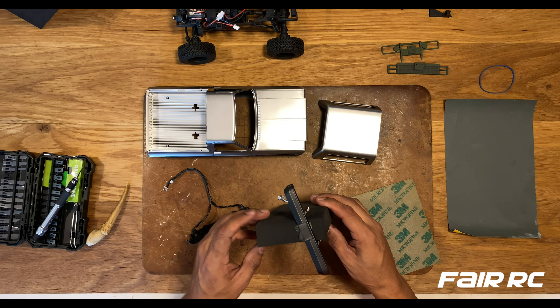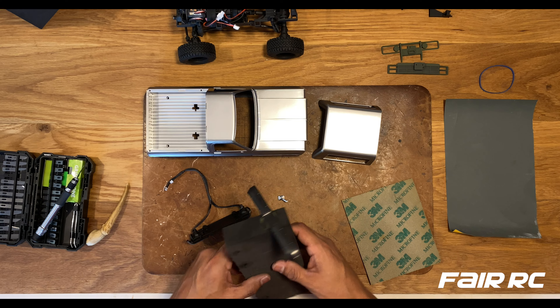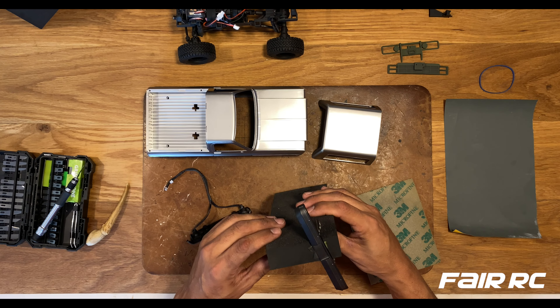Now when it comes to chrome, I do use a little bit of heavier grit — I'll use a 1500 wet dry, and I do wet it. For the chrome bumpers, I did put a little bit of black primer on, just a very light coat, just to give the paint a little extra something to hold onto. I did sand it ahead of time, but still, it being chrome, I didn't want it to come flaking off in some spots.